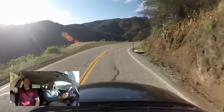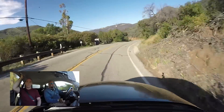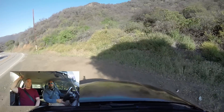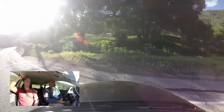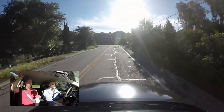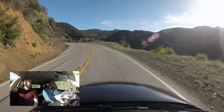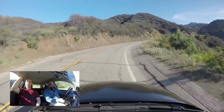Down the hill it's certainly got extra power. Let's flip around and go up the hill and see how well it gets that power down, because front-wheel-drive cars traditionally have some struggles going up the hill on power. It's got a fresh alignment so it oversteers more than understeers right now. You don't really get boost until about 3,800 RPM — four grand is where you really start getting some boost, but if you keep it above that, wow.